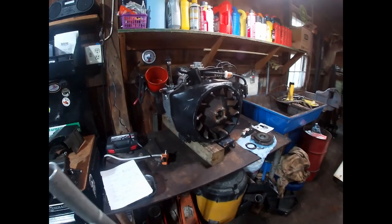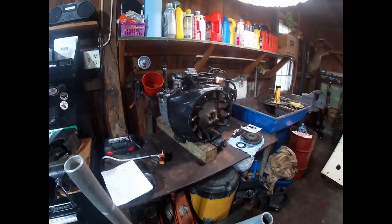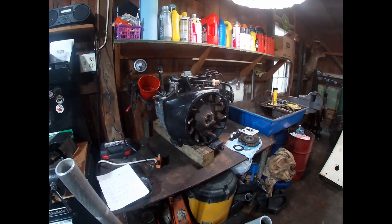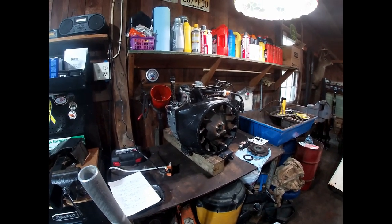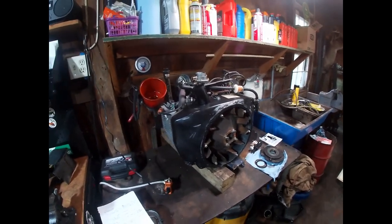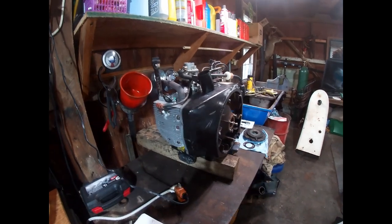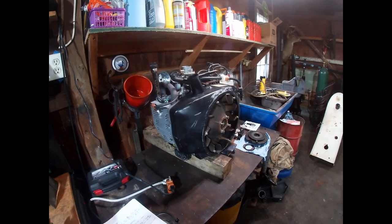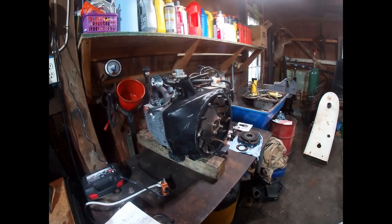While it's not running as fast as it could be, the engine is still basically going to overheat — whether if you let it idle too long, it's going to build up a lot of heat and not pull in enough cold air to displace it. As your RPM decreases, the amount of cooling air it pulls in also decreases, which in turn allows the engine to build more heat. Onan P-series engines in particular are notorious for wiping out the valve seats because of a thin steel valve seat pressed into an aluminum block.